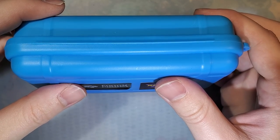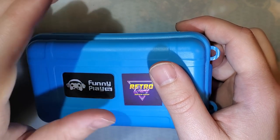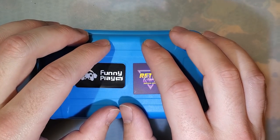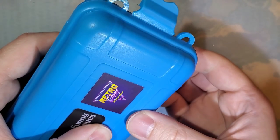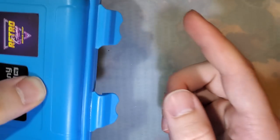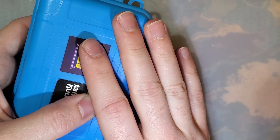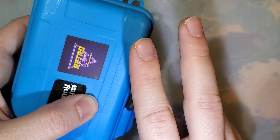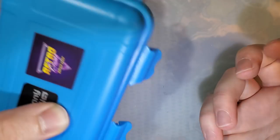Like, this kit, I'm stumbling over my words here. I'm not as prepared as I thought I was. This kit and the other IPS kits that use a ribbon cable adapter have little solder points on the ribbon cable itself for you to attach wires to for touch sensors or for button controls or something like that. I already mapped out those two solder points for other people in case they accidentally rip those pads up. I wanted to give them some alternatives here.